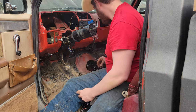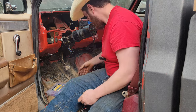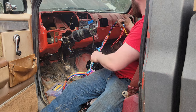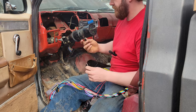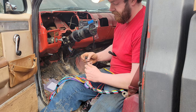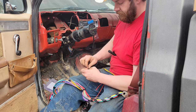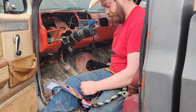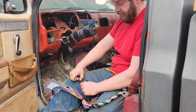How I'm doing these connections is pretty simple. I have these solder connections. Let me find my blower motor wire. I have my two connections here — this wire is a lot better than factory. You get this, put it over your solder connection, put it over one end. Get the two wires and spread them out a little bit, push them together, and bring that solder right into the center of them. Then you just heat them up — nothing to it.